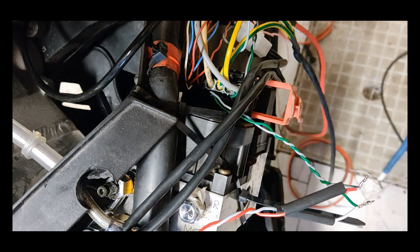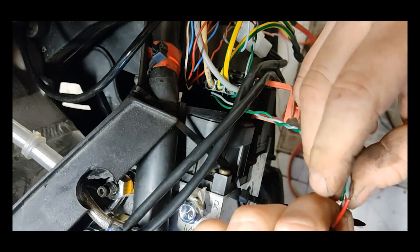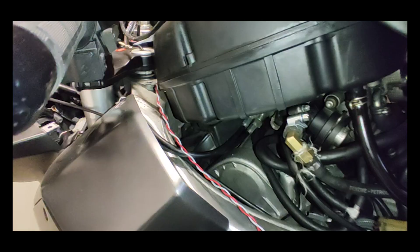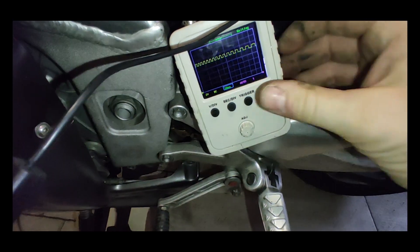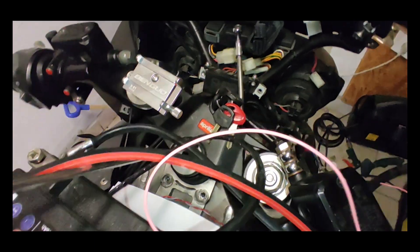Here's how most of this job looked like. I had to check ABS sensor polarity, as this is not a very well documented part of any wiring diagram. To do that, I hooked the ABS unit to an old battery. I can get a nice square signal, so it's OK. Every exposed joint or connector has to be protected against moisture — in this case, I used a hot glue gun.